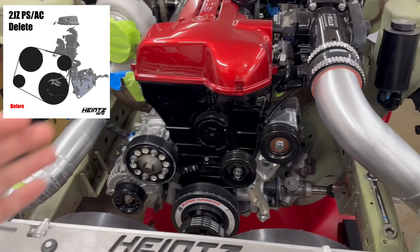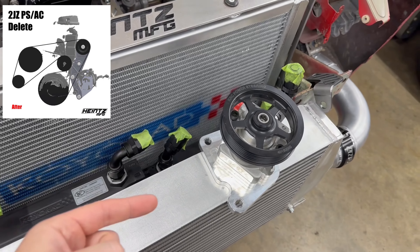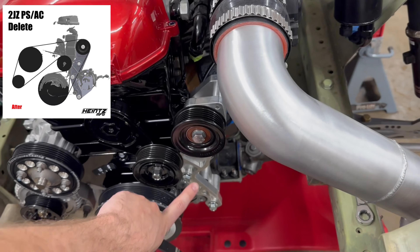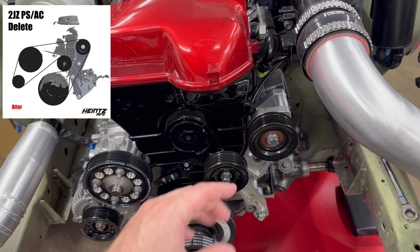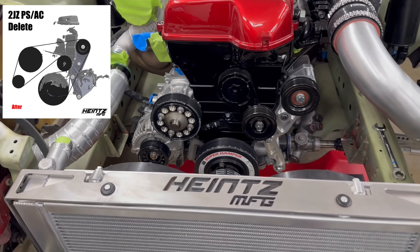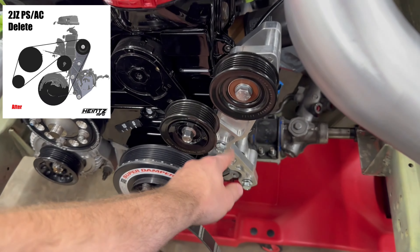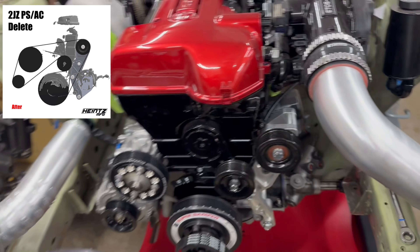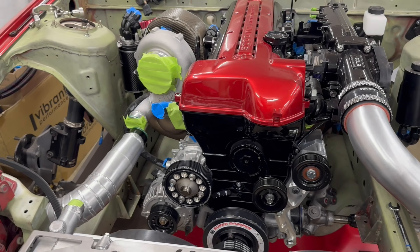I'm trying to get ahead of that and design this solution. It's for people who run electric power steering or a RAD Industries KRC power steering pump setup. The version shown here is for electric power steering — it comes with shorter spacers and attaches straight onto the oil pump. The goal is to change the belt routing similar to people who just remove an AC compressor, so there's a ton of increased surface area on the crank pulley. For people that run the KRC pump like myself, this gets sandwiched first onto the oil pump, and then this bracket I designed comes out in front of it, with longer hardware, longer spacers, and a shorter spacer for the pulley so everything lines up equally.